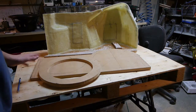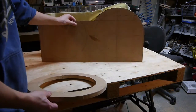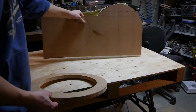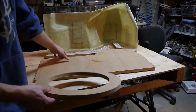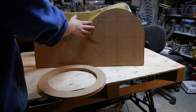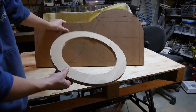The fiberglass is pretty much done right now. I did cut out the curve and sanded it down a little bit. I also cut out this faceplate, which is going to be mounted like so, and I'm going to stretch some fleece over it. I just cut out this ring, which is going to be mounted on the back side of this plate. I'm going to use a router to cut out the inner hole so that the speaker will stay flush with the MDF plate, and then this ring will be glued and nailed down on the back side so the speaker can have something to grab onto.